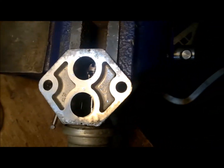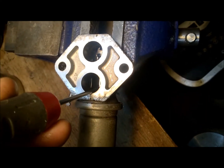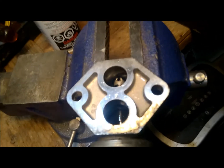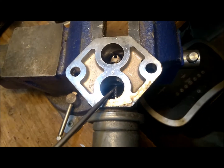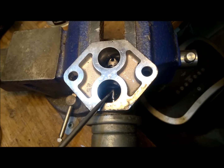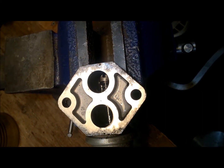When you push the valve now, there's no noise — you can see that. The gap is now much narrower than before. The gap between the valve and the hole is much smaller, which is why the idle was getting really high. Now I believe it will be good. You can see it's much better and much cleaner inside. Thank you for watching!